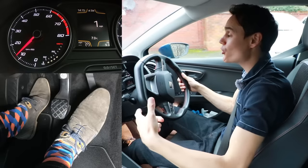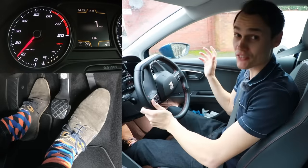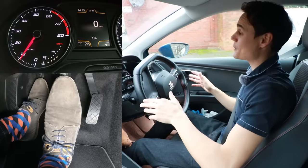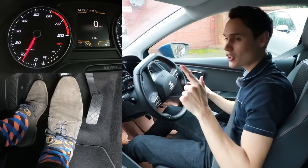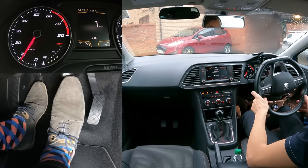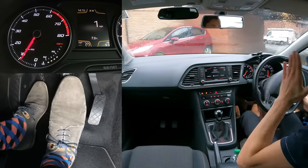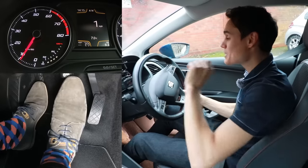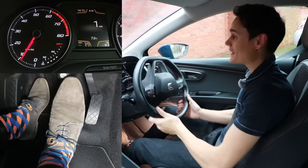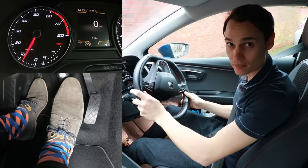What does wear the clutch is when people keep their foot on the brake, lift the clutch to the bite point, and control the car's speed with the brakes. They're constantly on the bite point telling the car to go, but then using the brake to keep the car slow — so the clutch is constantly fighting the brake. It's like a tug of war, and that's not good for clutch wear.